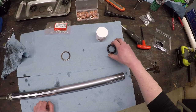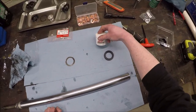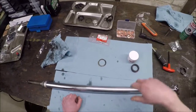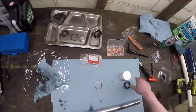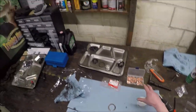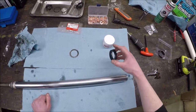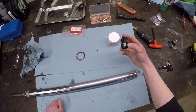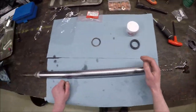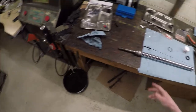I use a little bit of red rubber grease on the inside and outside of the seal to help seat it. I've learned to use red rubber grease instead of something like Valvoline SynPower with molybdenum, because the petroleum distillates in that type of grease can and will react with rubber and degrade it quicker. Red rubber grease or something like Super Lube silicone O-ring lubricant won't affect the rubber - in fact it'll help preserve it. I'm also going to use some cellophane over the top of the stanchion just in case, so you don't nick the seal on its way down.